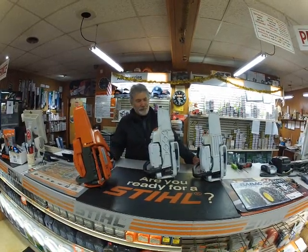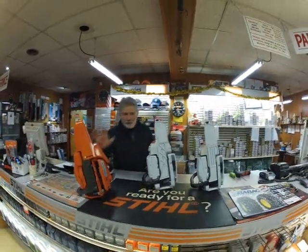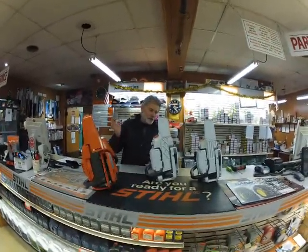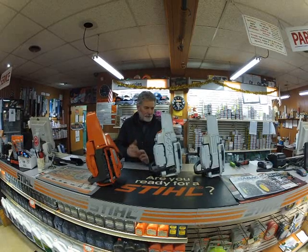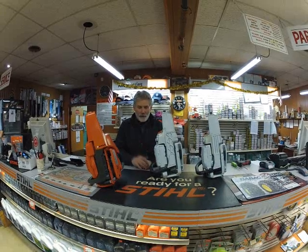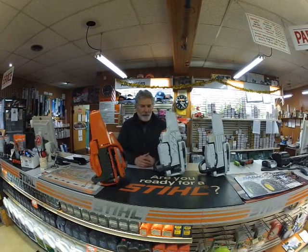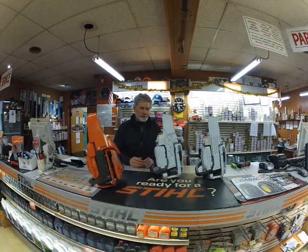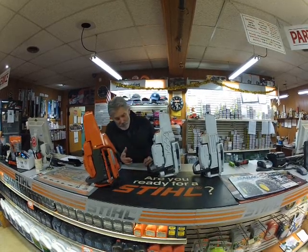Modular saws, you know, pick it up, feel it, put it in your hands, because that's going to make the difference. Don't compare this to Grandpa's saw, because Grandpa didn't have that saw. Most likely he had one of the earlier generation split crankcase units, which has different power characteristics and lifetime characteristics. Doesn't make these bad saws, but it doesn't make them the same as the predecessors. Different ball game. Price reflects that. Warranties are comparable. Husqvarna does have a lifetime warranty on their coil. Stihl does not anymore, but we don't have any failures, so don't let that freak you out. That's really not a big decision or buying difference for us.